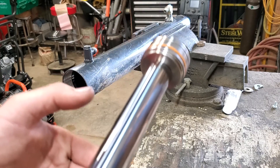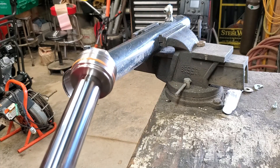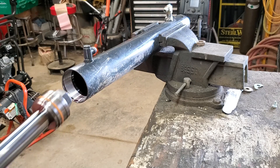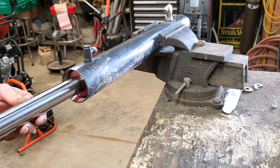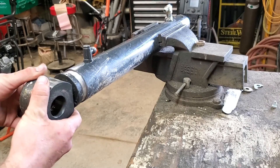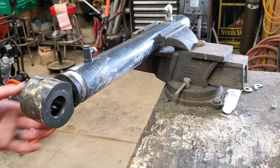I'm going to swab the tube, make sure everything's nice and clean, and then we'll start reassembling. Now we're going to reassemble the rod — sorry, the tube. Put a little bit of oil on the seals, right into place like that, and we'll screw the cap on.